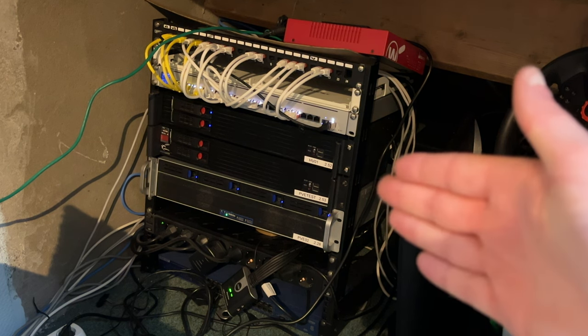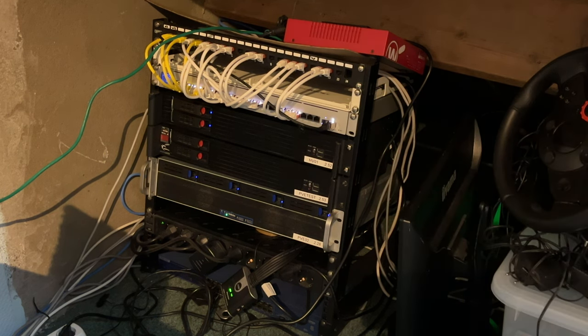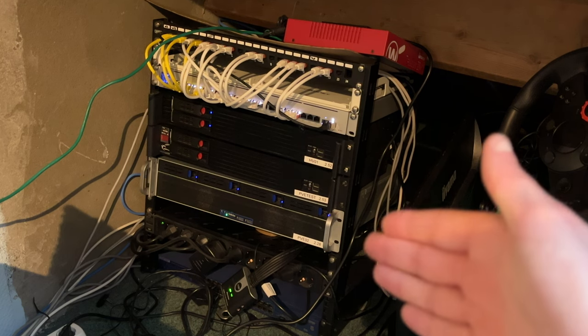Below that, we have the main server for our home network. It's titled HV01 because it's running Hyper-V and it's the first server. It's based around a 10th gen Intel Core i5-10600 on an H510 ITX motherboard with an NVMe SSD for boot, two 8TB hard drives for storage for the Plex library, and another internal SSD that hosts some other stuff. It's using shared storage to actually run the VMs on. That's the bottom server right there.